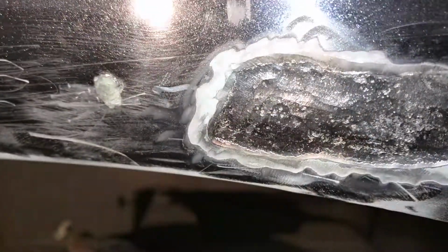As you can see, if you look closely, there is no rust left. It's just pitted from the corrosion that had eaten its way into the metal. And that's actually a good representation of how much material is now missing. However, since it doesn't go all the way through, it's not going to require fiberglassing it in or anything like that. However, I'm going to need some body filler.